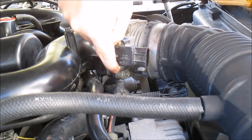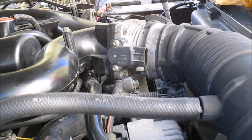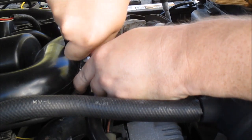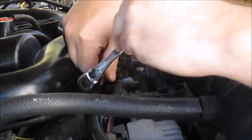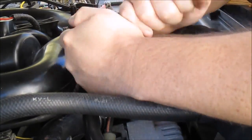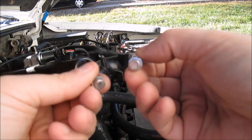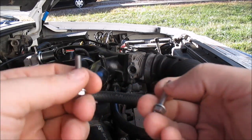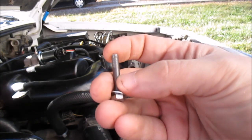There are two Phillips head screws and they look kind of stripped out — yeah, that's not good. I went to the hardware store and got some new bolts. I didn't get any with stupid Phillips head screws — I got actual bolts. They're the same length: 5 millimeter by 30 millimeter, 0.80 thread pitch, in case you want to replace those.